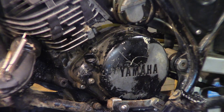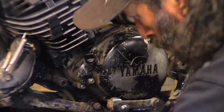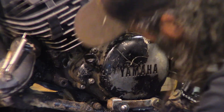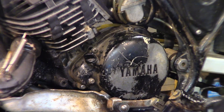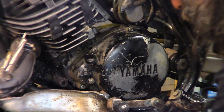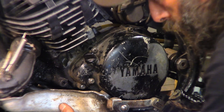It's not going to work perfectly right away because the oil has to get in between the plates and do all its things, so it might be hard shifting for a little bit until everything gets soaked through, but ideally it won't take long to break that in. We just got to put the skid plate back on — it's not all mangled, which is nice. I don't think this bike has a lot of miles on it. I've only put 16 on it, but I don't think it was raced. There'd be a lot more broken worn-out things. Swing arm bushings and everything, I don't think have ever been replaced, and they're still decent, so I don't think it was ever abused.